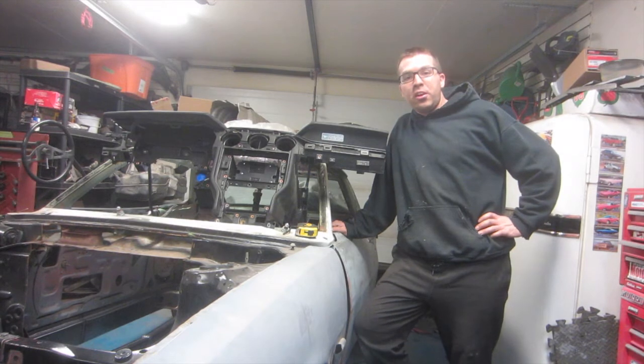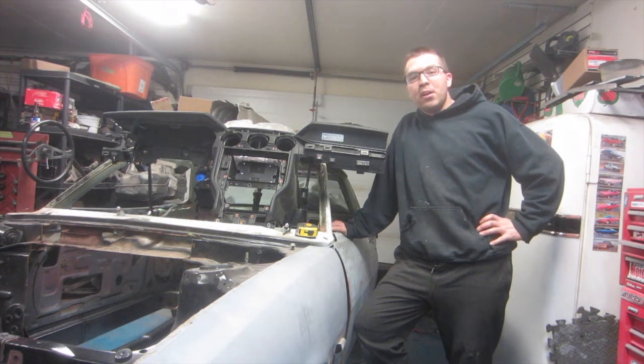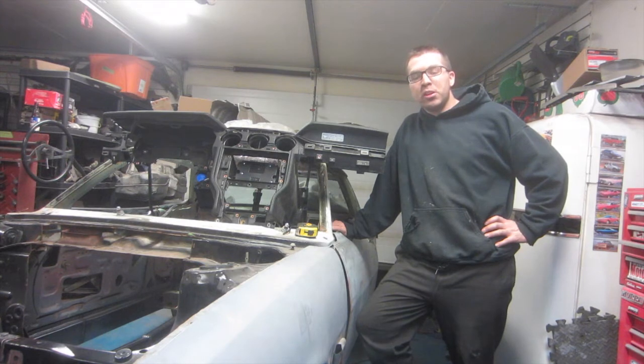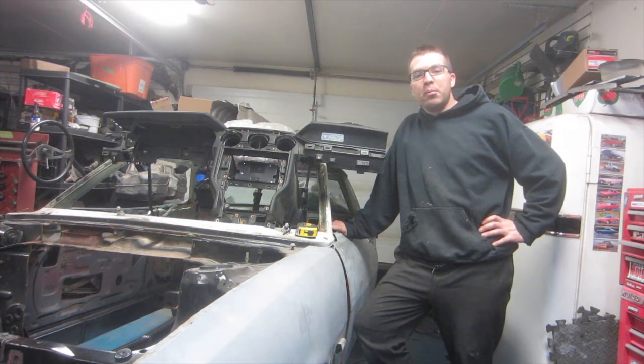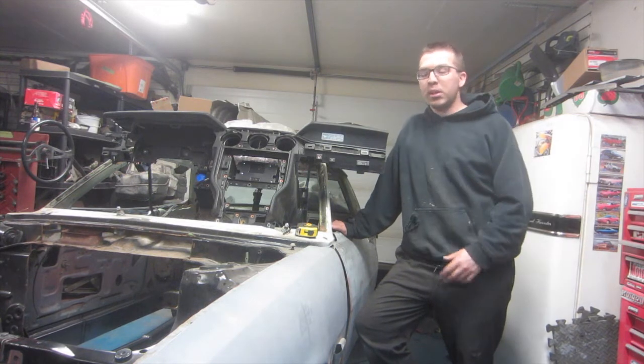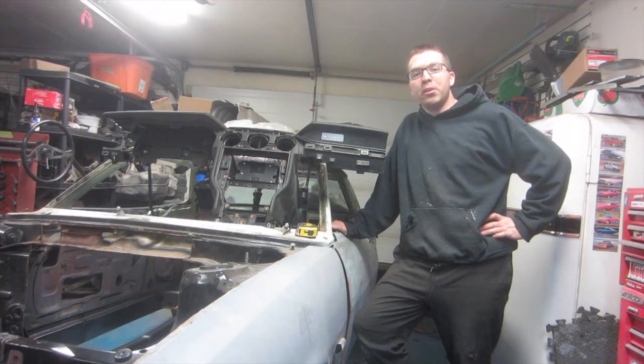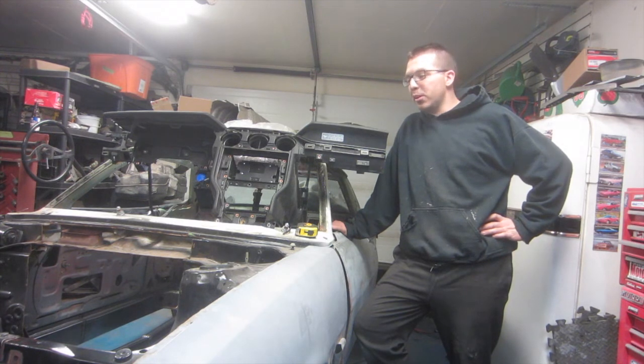Thanks for joining us on another episode of Dad's Toy Garage. In the next episode, you'll be seeing us do some more metal fab. I realized today I got to go over some rules for how to build a roll cage, what's legal and what's not. So I got to do some research on that before we do too much roll cage stuff. But next time, throughout the next week, I want to tackle the engine bay of this car, cutting everything out of there, leaving minimal stuff there. We're going to be building new frame rails so we can get the proper height on the Miata subframe front suspension. So that is going to be one of my priorities this week on this car. And yeah, thanks for watching, and we'll talk to you next time.